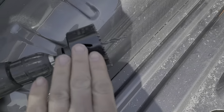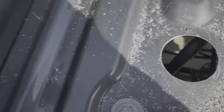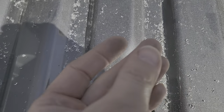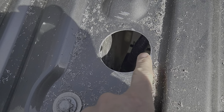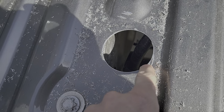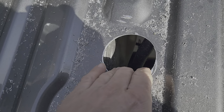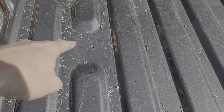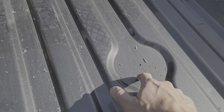You can see we used our hole saw to cut through. Be careful when you go through it — don't just put all your power behind it and shove it through. There's a wire harness way down there and if you shove the drill that far down it could damage that. You can see there are a lot of metal shavings — don't wipe that up with your hands, that stuff will create metal splinters. Towards the end I was lifting up, being careful not to push through. This has gotten scratched up but it's okay because I'm going to put a spray bed liner here after I get this in. I wanted to install this before doing that so all of these edges are covered to help prevent corrosion. We'll deburr this with a metal file, and then we're going to repeat that on all of the other holes.